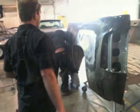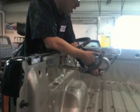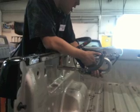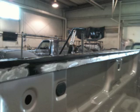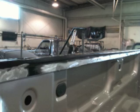Now in the next few photos you'll see where we are using the spot welder, resistance spot welder, and what that is, it's similar to the factory spot weld where it compresses the metal together and then welds it together. And no filler material is used, no filler rods, it just fuses the metal from the heat. And this is real good. Now before you use this, something you might keep in mind is it has to have metal contact. So where you're welding at, you need to remove the coating so that whenever it welds it can make a good connection and make a good weld.